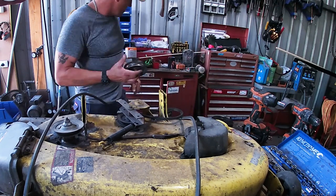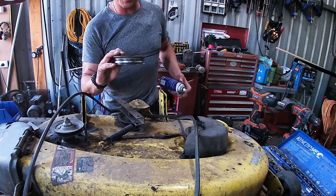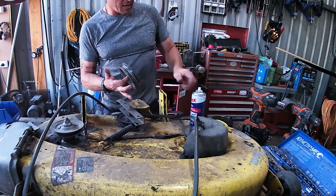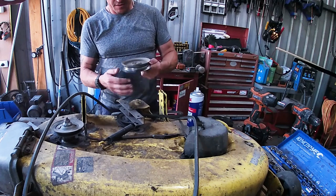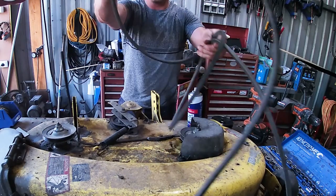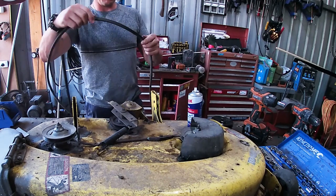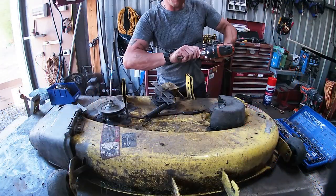It's not that great for the price it would cost to replace this bearing in this pulley, because on a lot of these the bearing is captive — you can't just press it out. We'll just get a bit of something in there. I'll inspect this pulley now and keep the spare belt, but pretty much I just run them right till the ragged end until they wear through. That belt's fine — we'll put that back on in a minute.